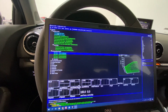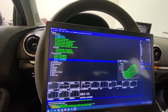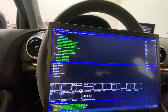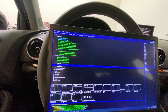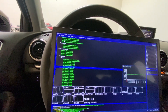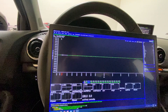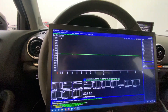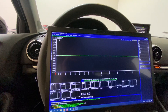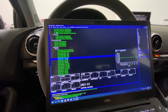As I explained before: base map 1 is Comfort by default, base duty 2 is Individual, and base 3 is Dynamic. On the RS3, base 4 is not used on V10 stuff - that's going to be your Performance or Pista maps. You have two things here: corrections and adders. Adders go through left foot braking for maps 1, 2, 3, and 4, meaning you can set it up to be more aggressive in Comfort or Dynamic. It's TPS versus brake pressure.